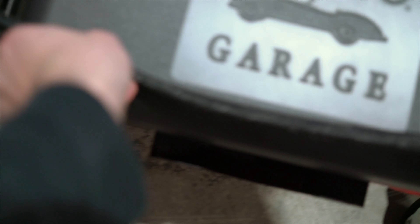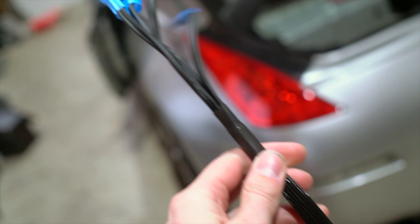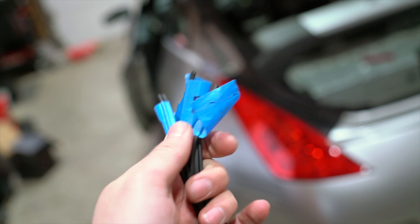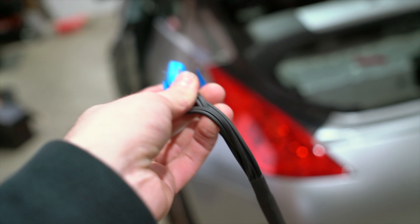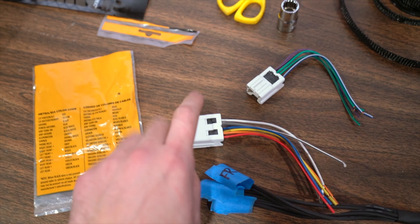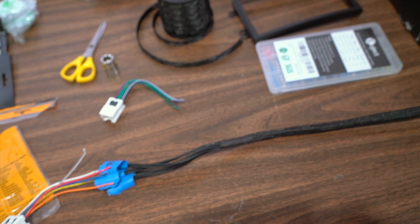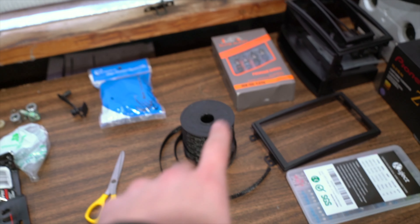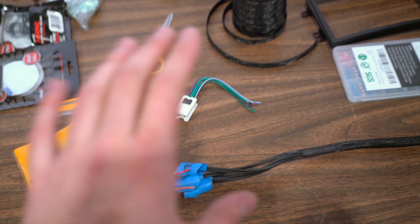I made this wire loom of all the speaker wire that's going to run from up by the head unit all the way back to the amplifier — got tucked into this wire cover all the way, heat shrink on both ends, and a little bit of extra wiggle room for where we're going to connect these up at the head unit and on the other end for where they need to go into the amplifier. The next thing I need to do is get these wires connected to the factory wiring harness. These go back to the amplifier, so once we connect the RCAs to the head unit that's going to run back to the amplifier, and then all of our sound will run through here and back into the speaker.